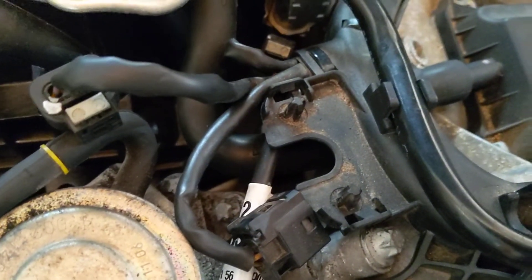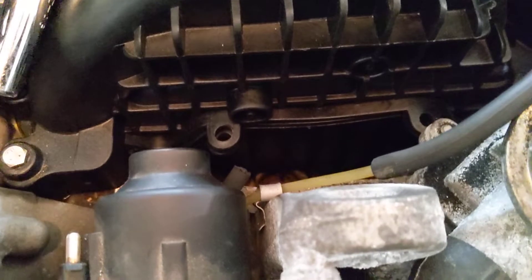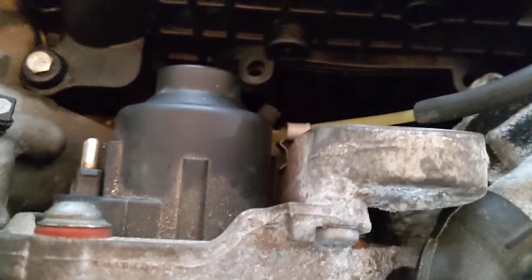I did elect to remove my MAP sensor. That will require some clever adjustment as far as I can tell, and there aren't too many tutorials on how to do this swap. The MAP sensor vacuum line runs into here. The secondary air line — if you can see down here, there's a line that goes pretty much straight across. However, I did have to cut mine in order to get the old manifold out, so I'm going to have to tee that and run another line. That line has the same sort of silicone you see coming off the fuel pressure regulator, so it's not something where you can just pull off the hose and pop on a new one, at least not in this position. Beware — you will have to run a little bit of vacuum line.